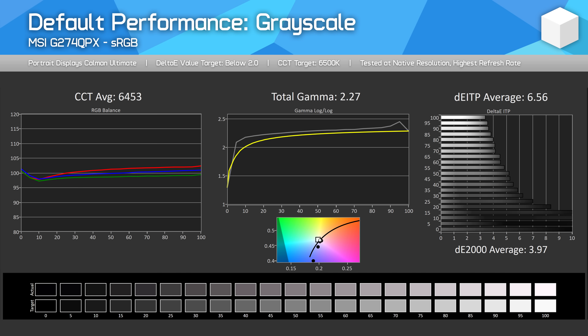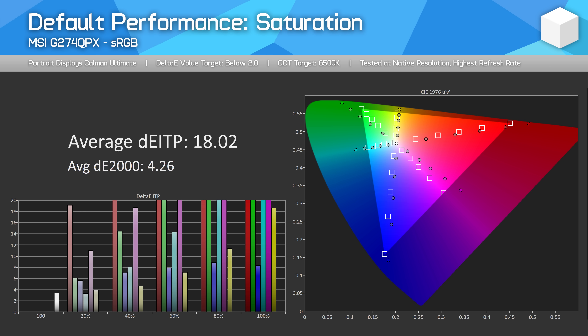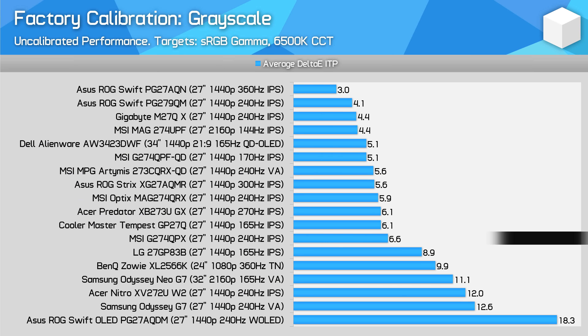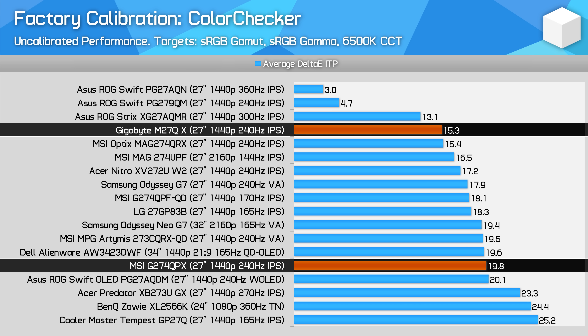Factory default performance is okay, not amazing. The color temperature of the display is great, though Delta E for grayscale ended up average. We also got some oversaturation for regular SDR content, as the monitor does not use a gamut clamp by default — sRGB content is expanded up to the P3 gamut of the screen, leading to weak Delta E's. Grayscale performance is mid-table and not as good as the M27QX, with a similar mid-to-low result for color checker, though the Gigabyte monitor has a lower color gamut so its level of oversaturation is understandably less.